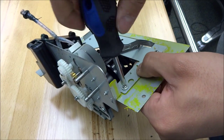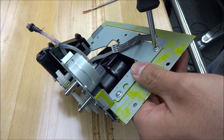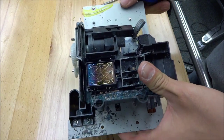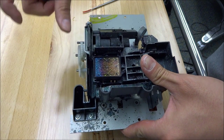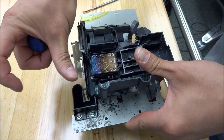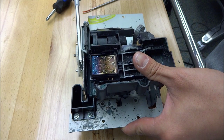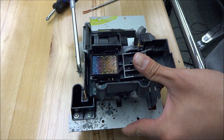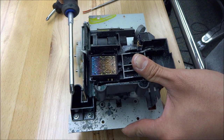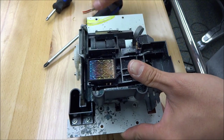While I'm doing this, I want to reiterate: if your frame is uneven, then when you go to install your capping station, when the wiper blade retracts outward — you have that spit cup right here — if this frame is tilted, your frame is going to hit with your wiper blade and you'll get a grinding noise. So this is your spit cup — notice how it's not straight. It would have to be straight versus like that. So that's what the frame would have to be straight for.